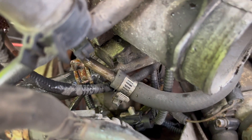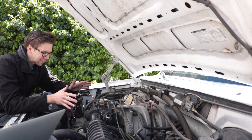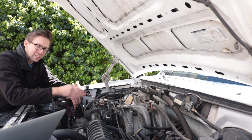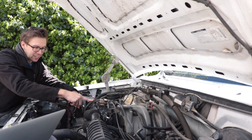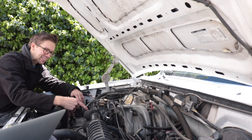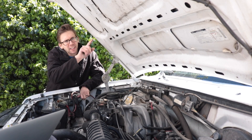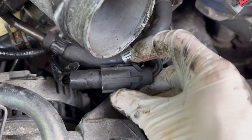Normally there'd be a tension clamp down here too, but mine has a worm drive so I'll loosen that up and disconnect it too. Disconnect the top coolant line before you disconnect the bottom coolant line. Why? If you disconnect the bottom first, it creates a siphoning effect with the top line and ends up draining your heater core. Weird things to find on your truck.